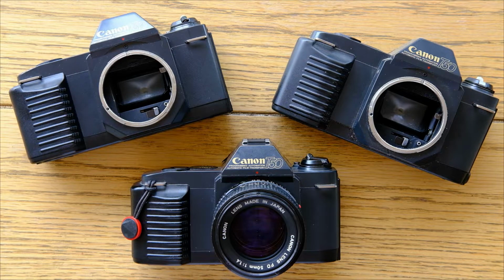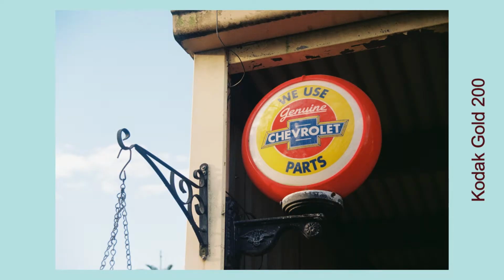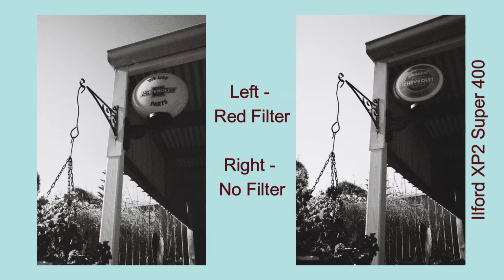These cameras aren't exactly reliable, and there's a lot of things that can go wrong in them. There's a ton of things that can explode in these guys, and honestly, it's the same story with any early electronic camera. The winding motor is likely to fail, the LED lights in the viewfinder can die, making it impossible to know what your exposure will be. The battery door, as I've already said, is made out of cardboard, and the amount I've seen snapped off is actually ridiculous.